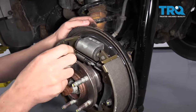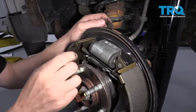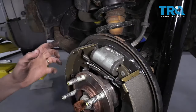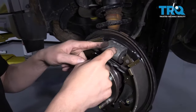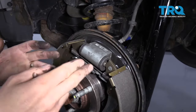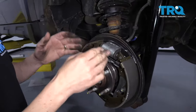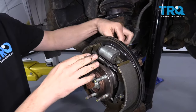This is your wheel cylinder. As I mentioned, there is fluid inside it and technically two pistons — one on each side. As the car gets older, the pistons start moving outward and corrosion builds up on the inside. When you put new shoes on, it pushes the pistons back in and they can get stuck on the corrosion inside. So sometimes you need to replace the wheel cylinder when you do the shoes. If it looks rusty and corroded on the outside, it's probably gross on the inside too. These are cheap enough that it's easy to replace them as long as you can get the line off the back.